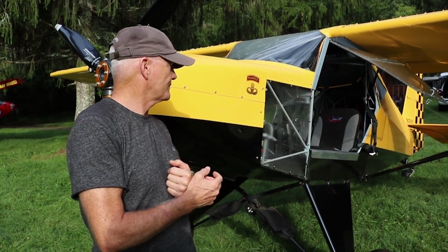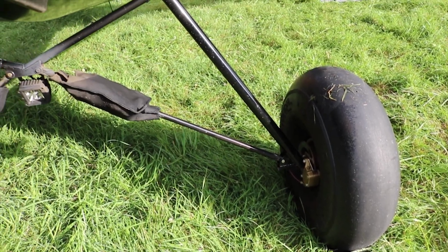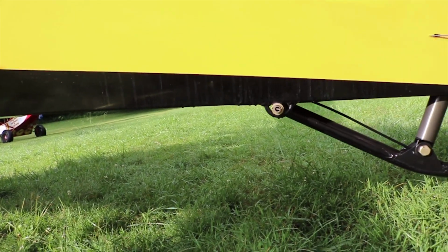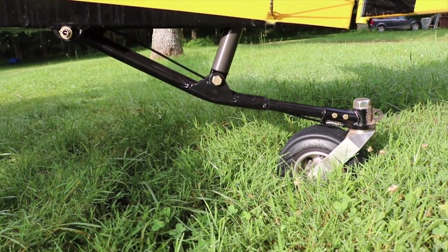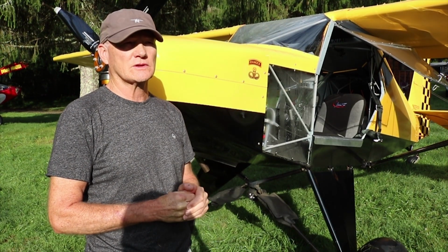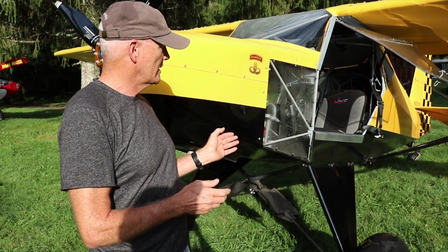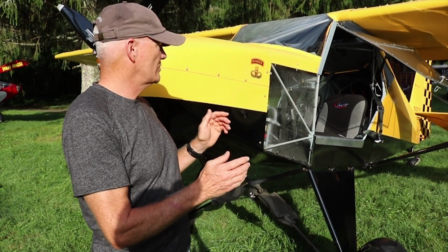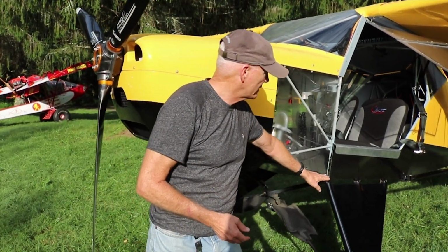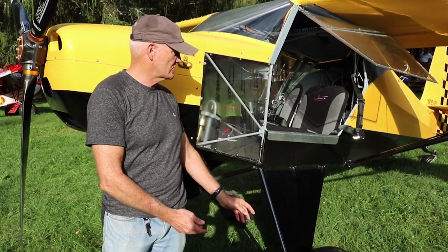The options that I have are the extreme landing gear. Is that a factory option, the extreme? It is a kit option. Yeah. So when you're ordering the kit, if you're talking with Billy or Chris or whoever you're getting your aircraft kit from, or Steve Henry, you can ask for just a standard Highlander, or you can have some options. In this case, the extreme gear is attached at 3 points here, and it's about 4 inches longer, and that accommodates the 26-inch Airstreaks really well.